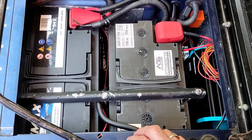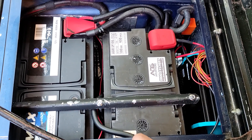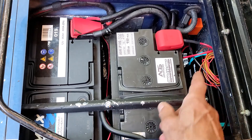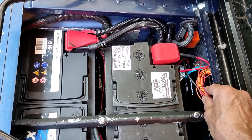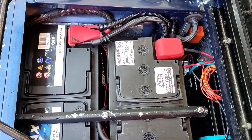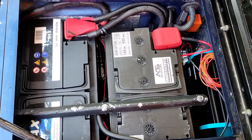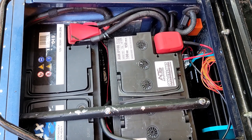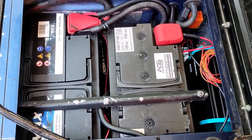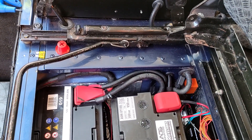I just need to test the battery-to-battery charge next and I'll do one more short clip on that when it's completed. The last job is to run this cable to a suitable location on the vehicle which is live when the engine's running. I'm also going to put a voltage indicator on so I can see what the charge is doing and the state of charge of the battery — so that's what the next section will hopefully show.